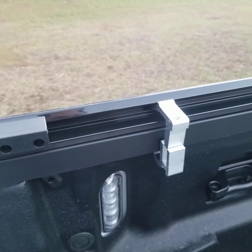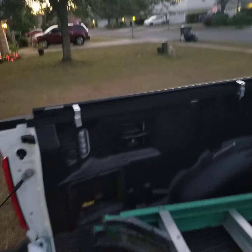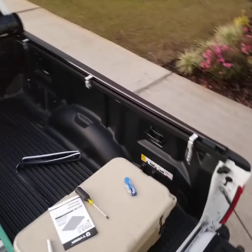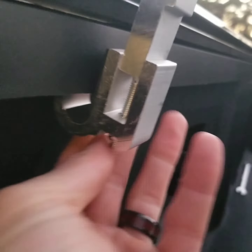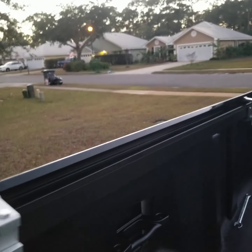From there, tighten the clamps down and then unroll the mat and tension it. It turns out you don't need the 10-millimeter wrench — just push the nut up into the locking part and use the socket. On the 2021 F-150 there's a small plastic clip that holds the top of the plastic bed rail, so make sure you do not place the bottom side of your clamp near that clip — make sure you have something solid to clamp to.